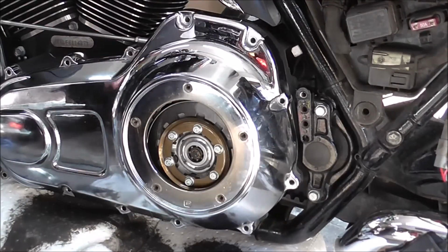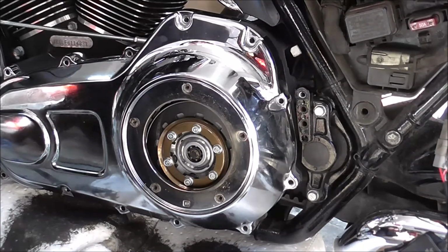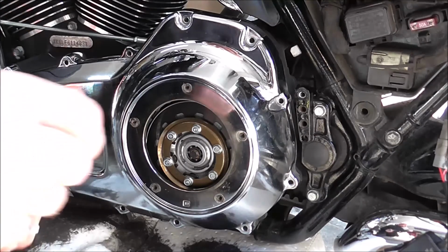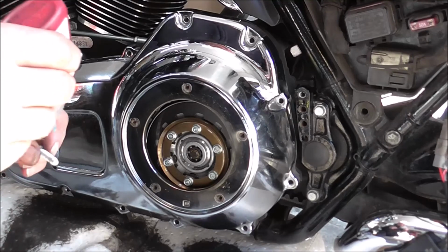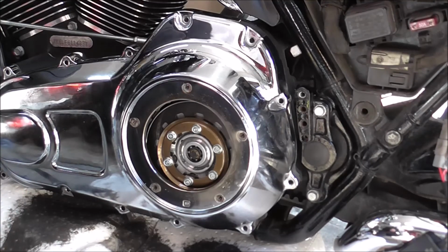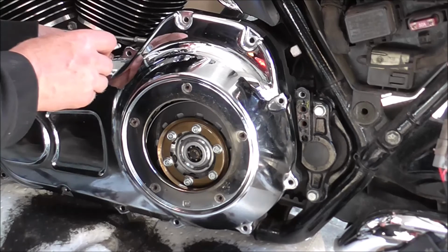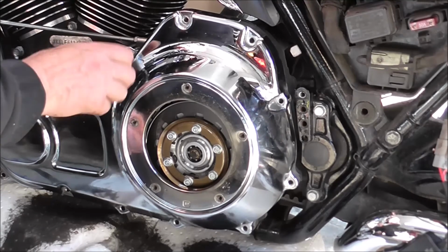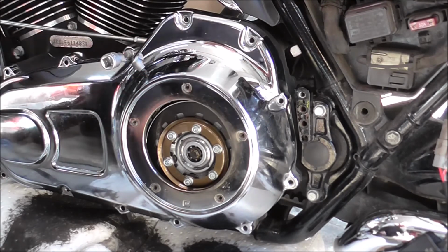We'll get a bolt. Cut the threads out a bit. On these, just the littlest drop of Loctite, it's all you need. Would help if you had the right size Allen key at hand. Now just till it touches, don't tighten it up, don't even nip it up.